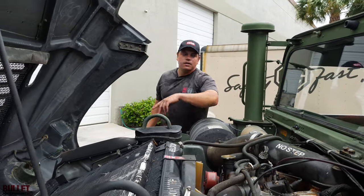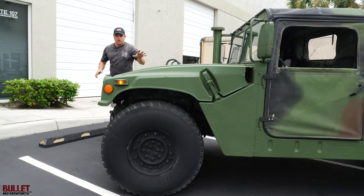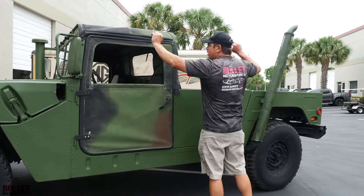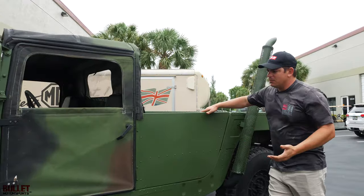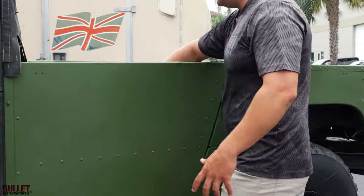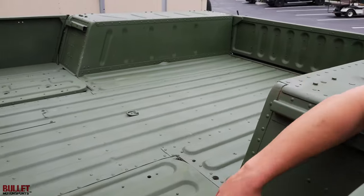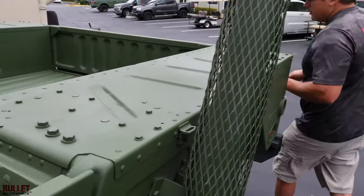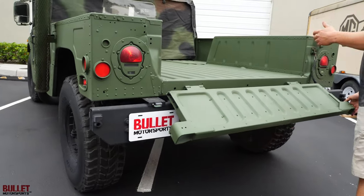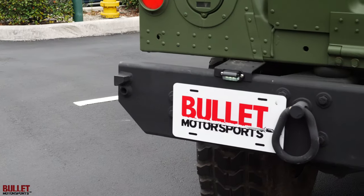It runs and drives excellent. We've taken it through its paces and we're going to do that again today. As you walk down the driver's side, you're going to see it's a pretty straight body. If someone wanted to convert this to a four-man truck, they can do that easily. All you need is a new B-pillar and C-pillar along with your crossover bar. You can actually reuse this B-pillar. They use all the same framework for all the models. The tailgate is all fresh and clean. It also has an airlift bumper and a tag light bracket with an LED light so you can be street compliant.